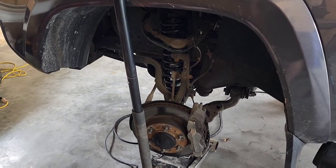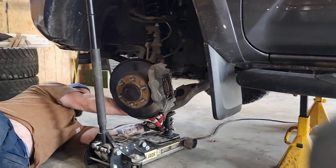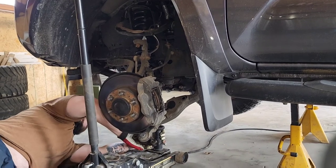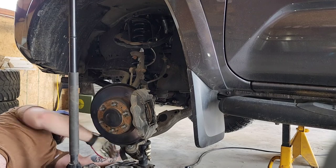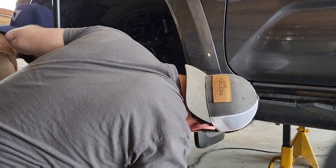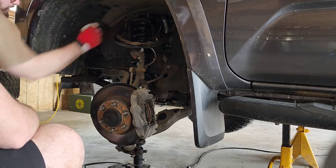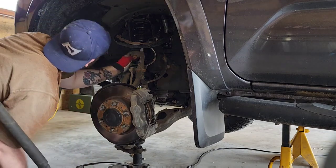Okay, so now we can actually jack this up. Put this on the mount — get ready to help. There you go, it's in the right spot. Now just jack it in a bit to get it in the hole. Rather than use a spring compressor, we've been doing it like this — we're going to use the weight of the truck to put everything together.